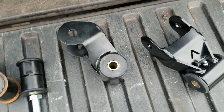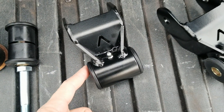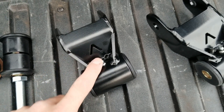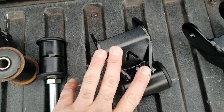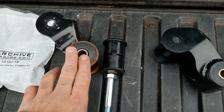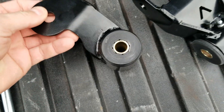Then we move up to the Archive Garage fabricated shackles. This one is the 3.6-inch shackle — it's got the 'A' lasered in, all welded construction, quarter-inch DOM, with bushings pre-installed so you just drop them in. There's a zerk fitting for grease — try to use grease compatible with polyurethane bushings. This shackle is ideal for spring-over-axle, which is the stock configuration for the six-lug trucks. It's comparable to the OEM with poly bushings, but the grease fitting means all maintenance is built in and it all comes pre-installed.